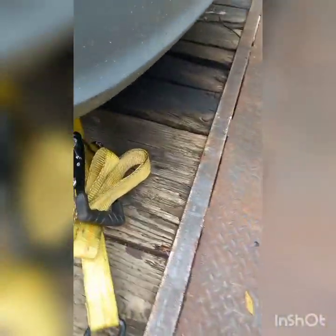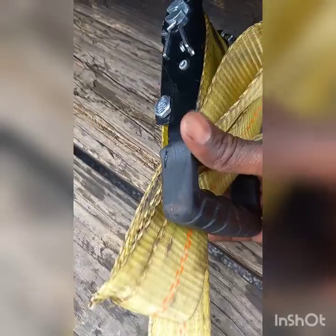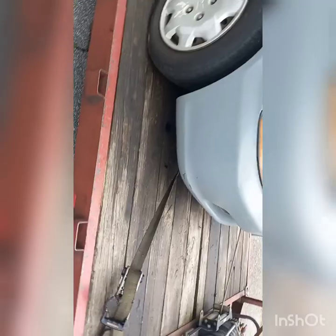Got my strap rolled up. Got my ratchet strap pushed back down all the way to the closed position. Got good tension here, good tension on the other one. Got it pretty secure — got the j-hooks pointing down so it won't slip out. Come around to the front, and I got it secure up here as well. That pretty much does it.